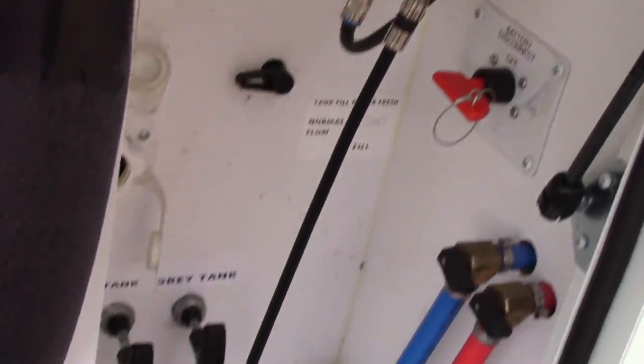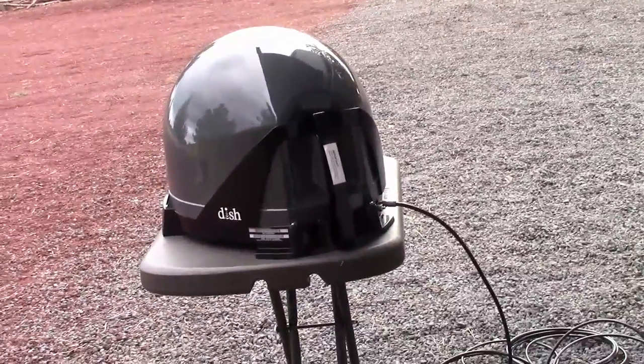Because we're not always in our RV, we chose the Tailgater, but there are pluses and minuses. One question we asked was: can we get on-demand or record things? Because of the Tailgater, we are limited to a different type of receiver. The Tailgater will only work with a 211 series receiver, which is not a DVR. DVR receivers give you access to video on demand. You can get pay-per-view if you're plugged into a phone line or have internet, but not video on demand streaming. However, you can add an external hard drive to the 211 to turn it into a DVR so you can pause live TV and record.